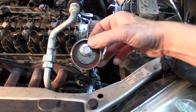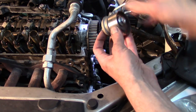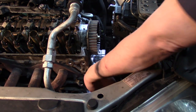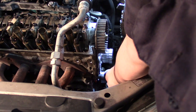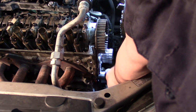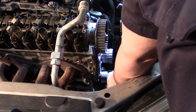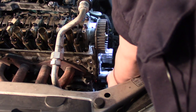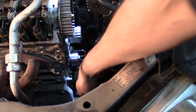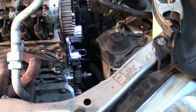The tensioner is a little bit oblong, so we're going to set it in so that the bolt is up at the very top, nearest the top of the engine, and then tighten it down until the bolt stops — don't go any more. Once the bolt stops, back it off exactly a half turn. The tensioner is going to be very wobbly and free, and that's exactly what you want right now.